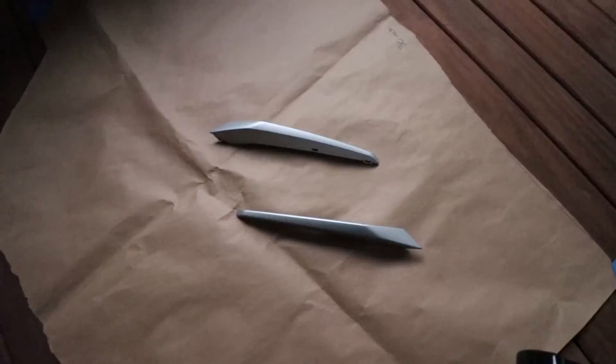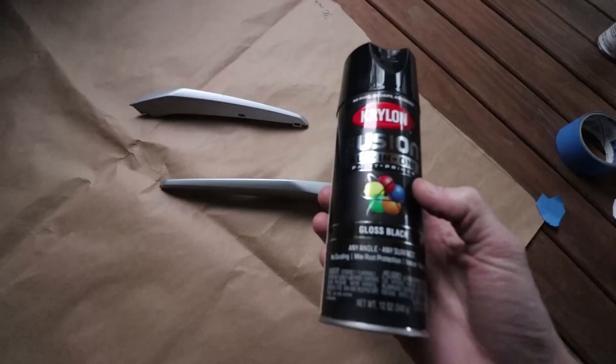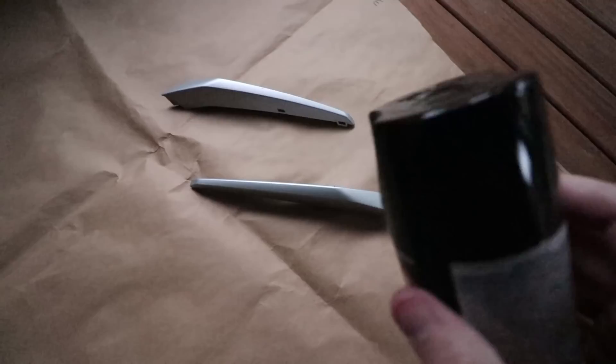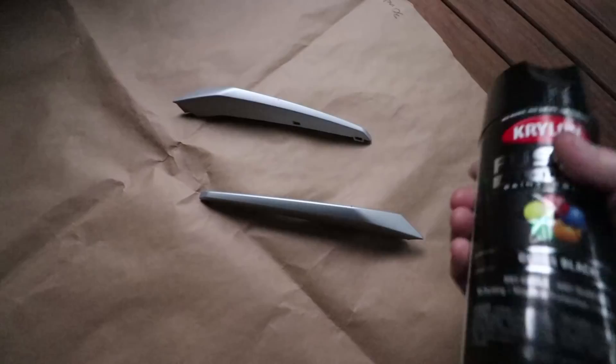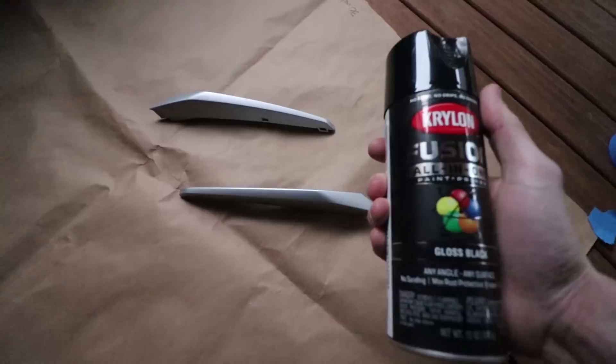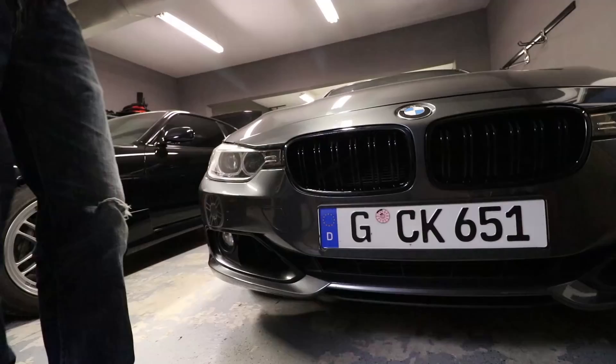Now that we have our whiskers off, I'm going to be using Krylon Fusion. I've had good success with this stuff on plastics — it seems to stick really well and you don't have to do a lot of prep. I hit these with acetone just to clean them off, get all the oils and dirt and debris off. I'm doing gloss because I think the gloss black will match the trim a little bit better. This was like $4 at Lowe's, so I'm going with Krylon Fusion. I put on about four coats, waiting 10 minutes between each coat, and after the last coat I waited an hour before handling the whiskers.